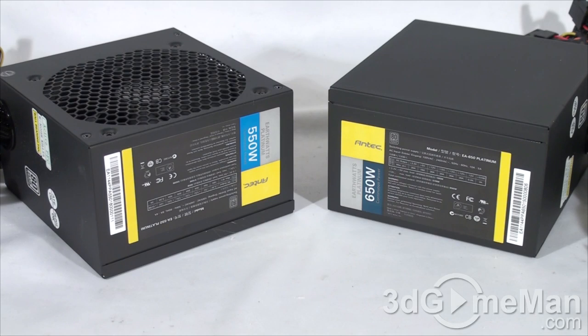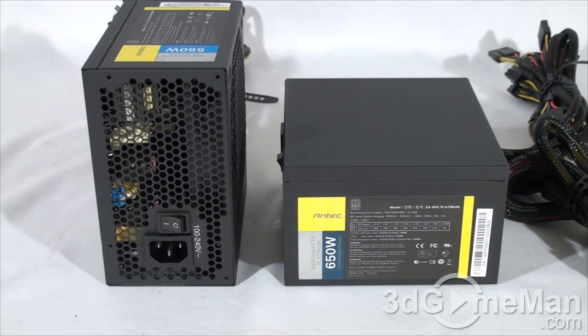There are a number of important things to remember when selecting a power supply. First is wattage — determine how much wattage you require based on your hardware. Generally, a medium to high-end gaming rig requires 500 to 700 watts. For a hardcore system, select around 800 watts. For an extreme gaming rig with multiple top-of-the-line video cards and lots of hardware, select 1000 watts or greater.